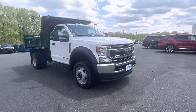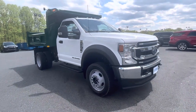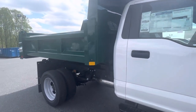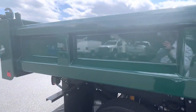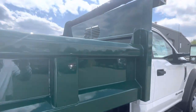Here's a tough one to come by — this is a 2022 Ford Super Duty F550, 145-inch wheelbase dually, with the Rugby Eliminator nine-foot dump body on it. These sides are 12-gauge steel, 17 inches high, 23-inch tailgate with 10-gauge steel floor in it. It's got the cab shield.